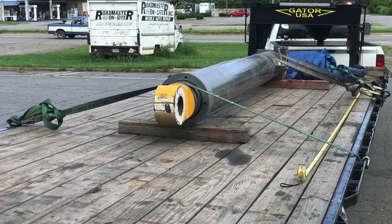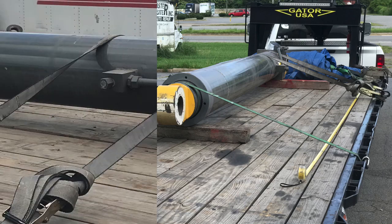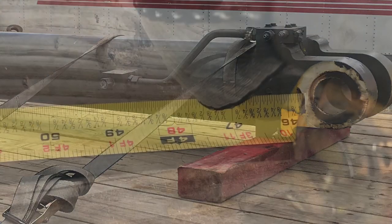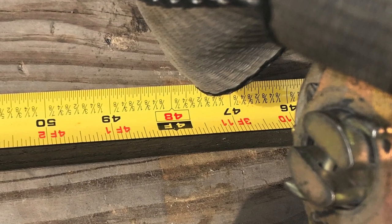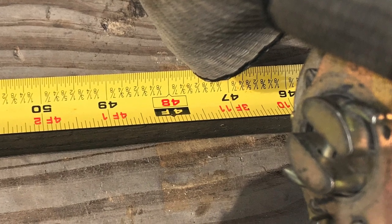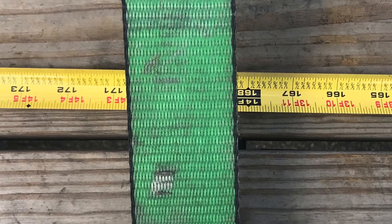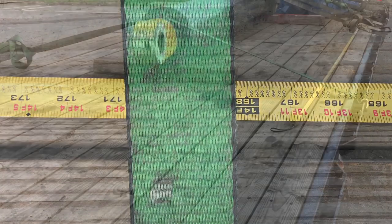The rear strap, if you can tell, it's strapped from the opposite side of the trailer. I do that to counteract the forces of squeezing — because it wants to pull that pipe in another direction. On the front one, like I say, first four feet — that second strap just so happened to be at four feet. I did not plan that. That last strap on the back at 14 feet just so happened to be 10 feet ahead. I didn't move anything; that's just how it ended up being.